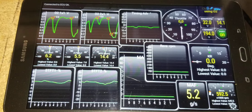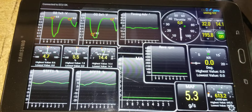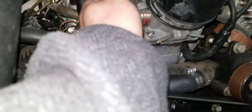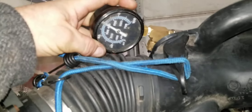It's at operating temperature, hasn't seen any knock, timing is stable, fans are working, fully heated up. You can see the oil pressure — it's good. When it's cold, oil pressure hits about 65. I kept the mechanical throttle body with the factory setup because we're running an Allison transmission. Fuel pressure is good — we're about 60, a little higher than normal, but that's good.